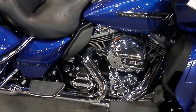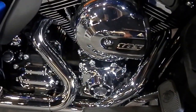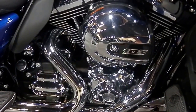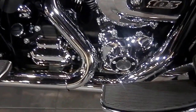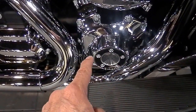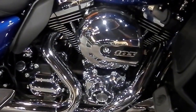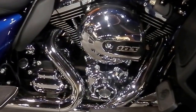The interesting thing about the 103 twin cam is not only does it run hot, but the flywheel assembly — a round flywheel with two connecting rods that drive the pistons up and down — is only pressed together at the factory with a 400-ton press. Unlike the previous Harley engines like the EVO, shovel head, and pan head, which held both halves of the flywheel together with a crank pin bolt and nut torqued down to keep it true. What happens is the pinion shaft, which operates the twin cams, and the silent chain drive for the oil pump, will begin to wobble out of true very quickly — as low as 1,500 or 2,000 miles. It's not uncommon to start seeing vibration, both halves coming out of true because there's nothing holding them together — only a wing and a prayer.